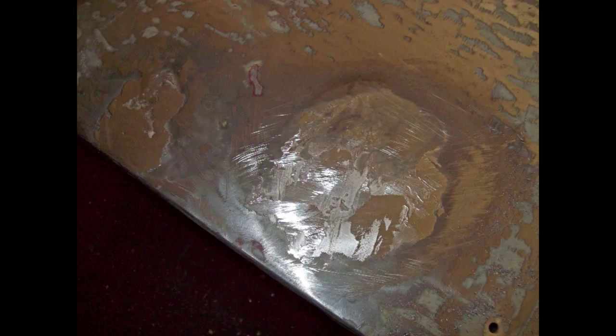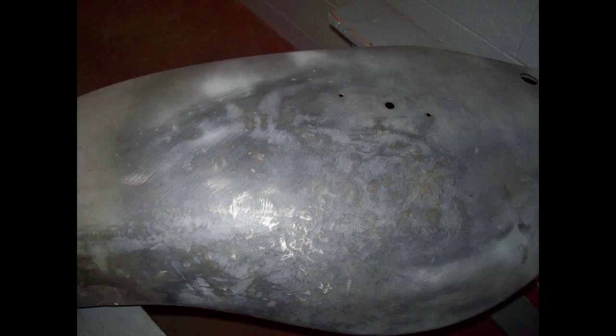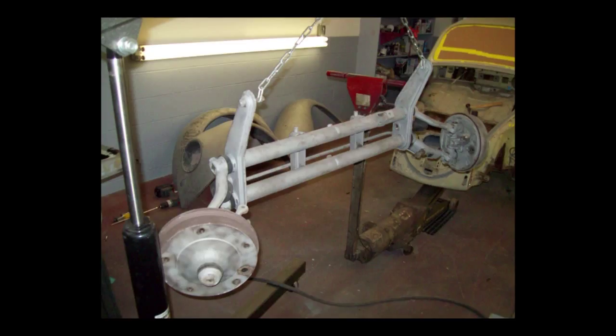More work on those areas. This is the left rear fender I mentioned that had quite a few dents in it and thick body filler. I've removed that body filler and just about have this fender ready. I decided to sandblast this front axle after I had cleaned and repacked the front wheel bearings, new seals, new wheel cylinders, new brakes. So all the holes have to be taped off carefully to keep sand out of the brakes.